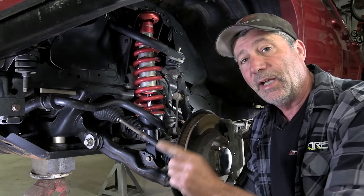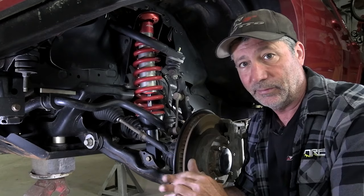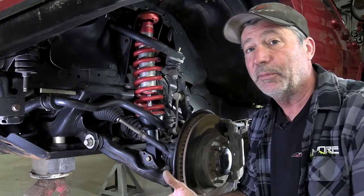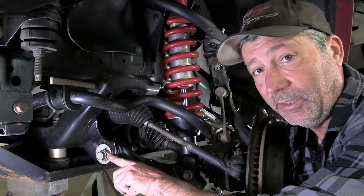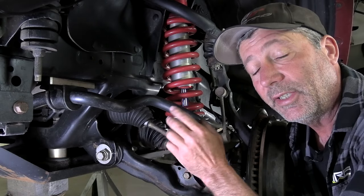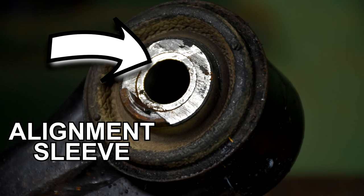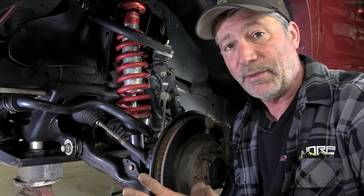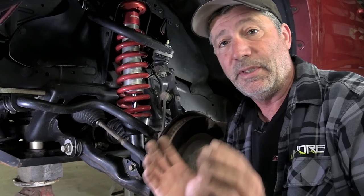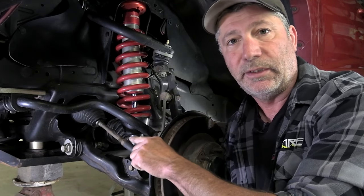In the front, however, that long bolt going through does not turn those cam washers — it just holds the lower control arm to the frame. The alignment adjustment is actually made by putting a wrench on here. This wrench surface is part of a separate steel sleeve that goes through the sleeve in the bushing. That steel alignment sleeve is actually what freezes up inside that bushing sleeve — not the bolt going through. Not in the front, anyway.